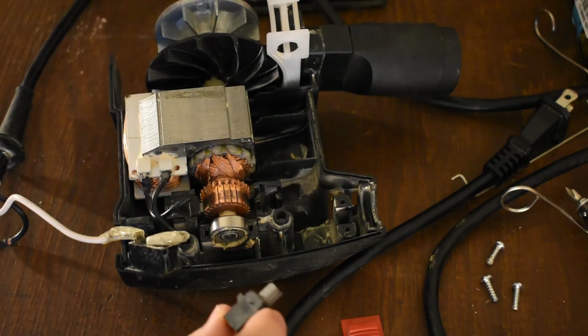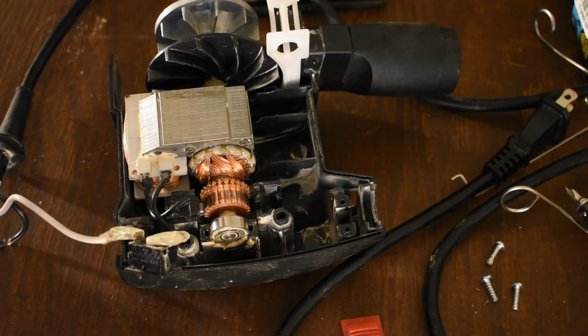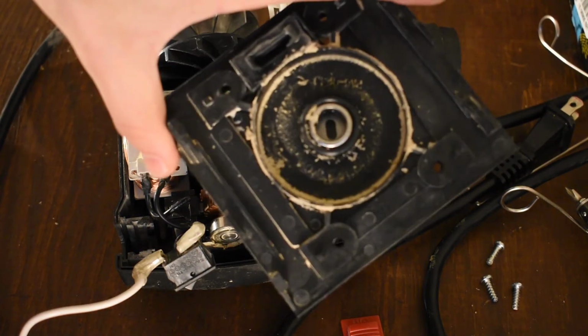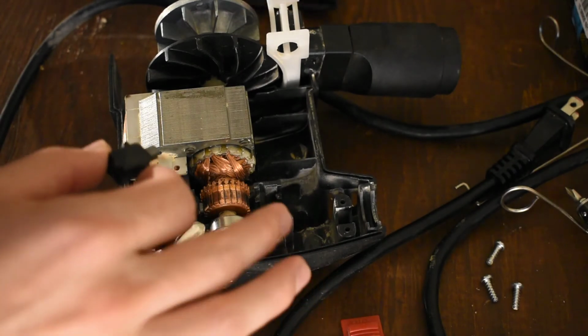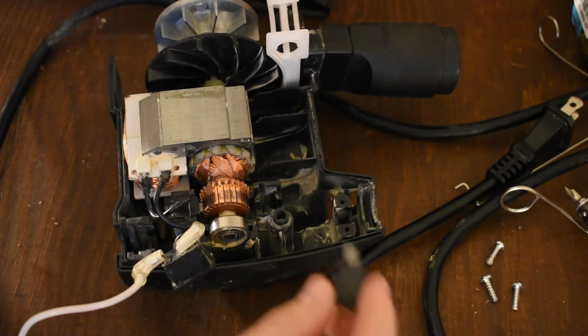That's actually what this is, I don't know if we're in frame here. No, we're not. So that's what the bottom part is that holds the sandpaper. This thing has some marks on it. PA6-GF30. So this part is glass fiber reinforced. So it's not entirely ABS, but the housing is. That's, again, to save money on the mold. They want the mold to last.